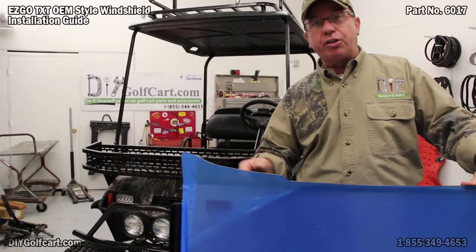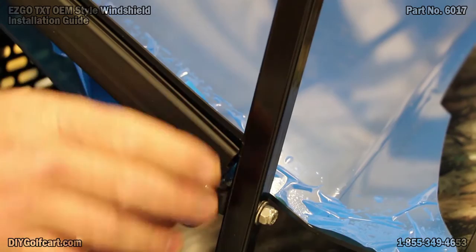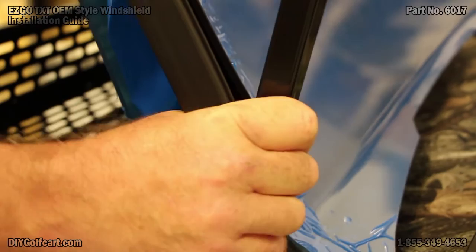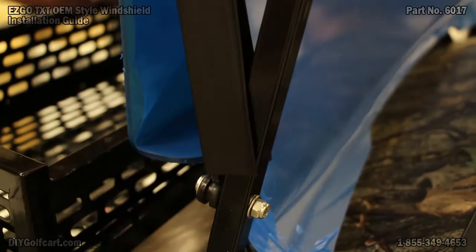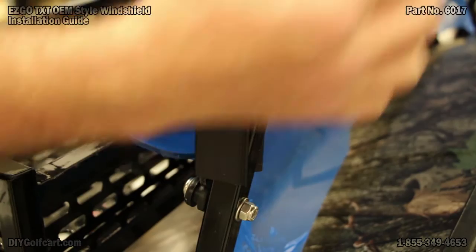Right here is where the rubber bushing that we installed earlier is going to sit. So what we'll do is we'll get the windshield, set it across, and right onto that rubber bushing. Once you get your windshield in place right over the rubber bushing, the bracketry here has got an opening with these two areas that stick up. You want to actually pry them apart and then slide it up onto the windshield upright like that. Once you get it started, you can do the same to the other side and then just slowly press it on up until it fully completes and engulfs this panel.